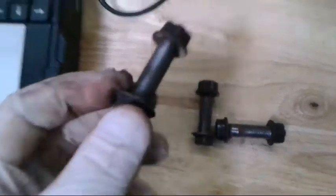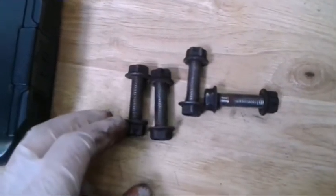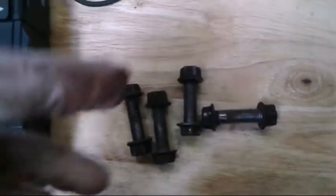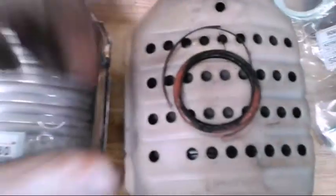I got my new bolts. I cleaned them up with a wire brush and a wheel, and I'm going to put a lot of anti-seize on them to prevent them from freezing up. Right now I'm going to put a rag into the exhaust pipe and clean the mating surface. It's important to do that — I don't want rust and dust getting on the O2 sensor. It might mess with the readings.